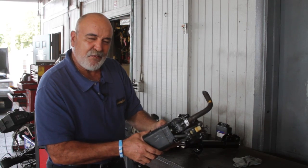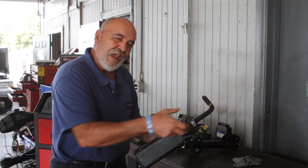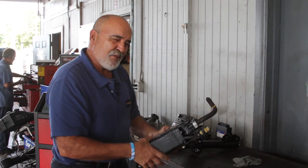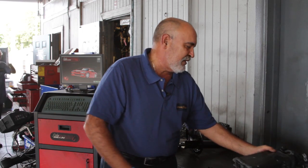These canisters tend to wear out and you can also accelerate the wear on them when you gas up. If you keep clicking the gas to try to get to that zero dollars or an even amount, you can damage these emissions canisters and they are extremely expensive.